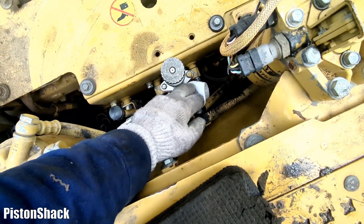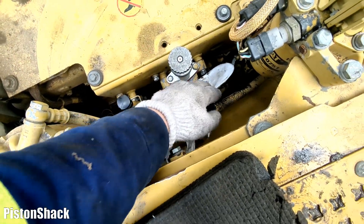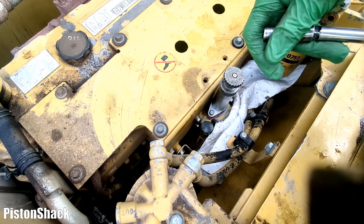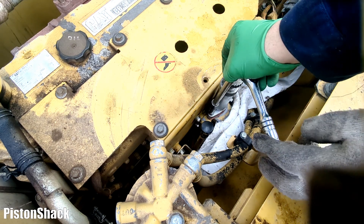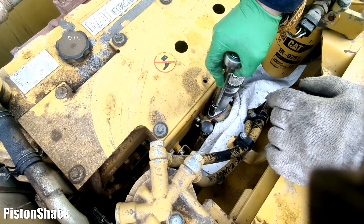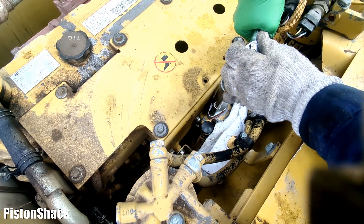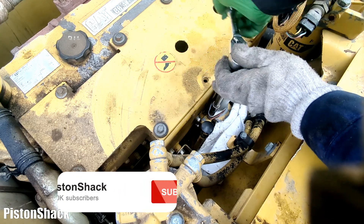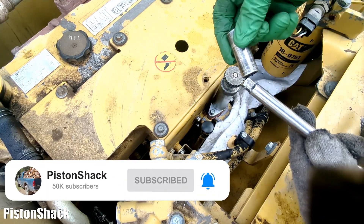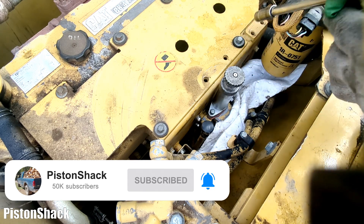Place a spill pad and towel below to make sure we won't spill any diesel. I'm using a 3/8 ratchet with extension to break the 10mm bolt loose first - it's pretty tight. If you're new to the channel, I'd appreciate a subscribe; it doesn't cost anything but really helps.